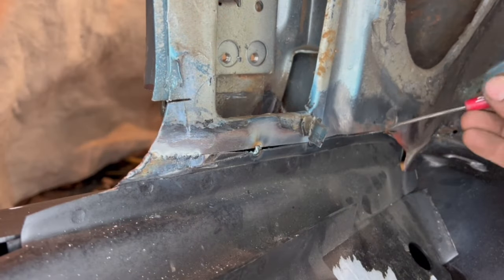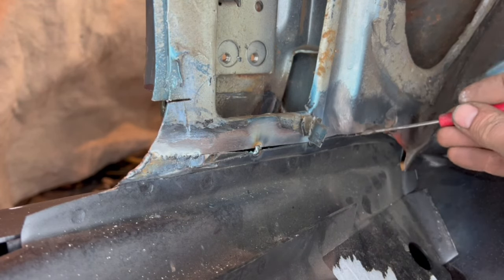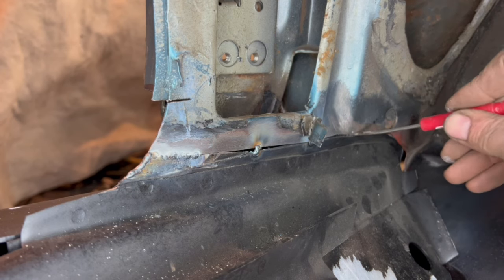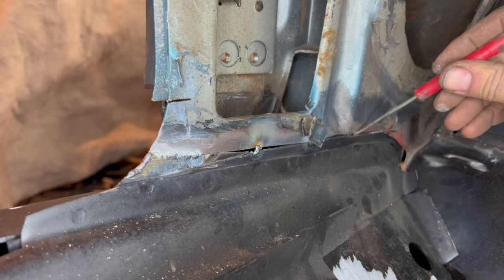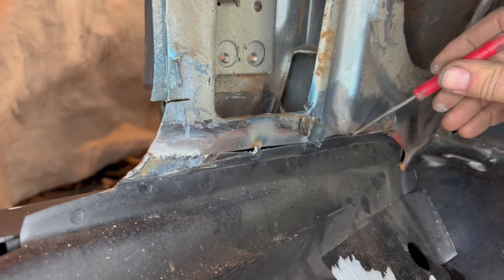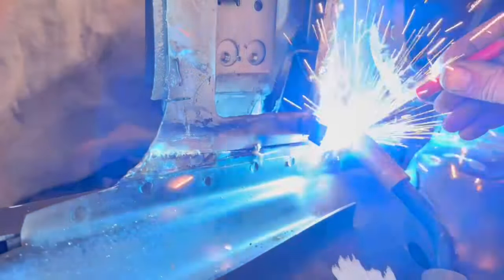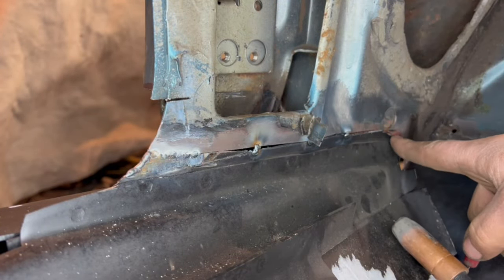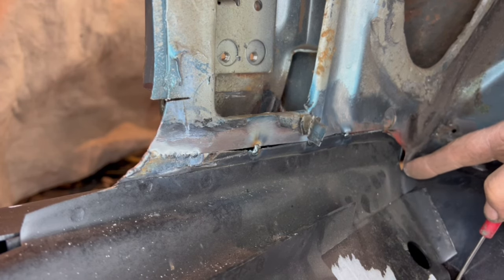Looking pretty good. I've got everything kind of where I like it in position, but the layers are a little bit off — the rocker is a little further back. What I like to do with my tacks is just take a little screwdriver — it doesn't take much but you can see it actually starts to move. I'll pry this to the same level and put a little tack into place. Now that will stay in position and we're at the same height. I'll keep working my way across the whole thing, then drop a couple screws through here so the front part is in place for finish test fitting.